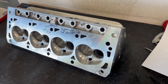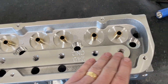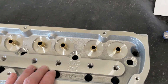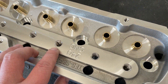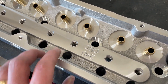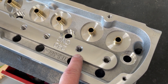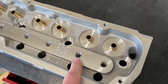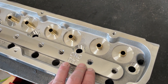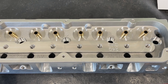Let's go over this head. This is the rocker bar where the stand would go if you ran shaft rockers - it's one piece. A great thing I really like about Ford heads that Chevys don't do as much: you can tell how many threads are engaged for your rocker studs. On a small block Chevy you'd have about half before it breaks through the port, making the head much stronger. The rocker boss is so much stronger because you've got more thread engagement. Chevys are more likely to pull out the studs. There's just more material on the Ford - love it.